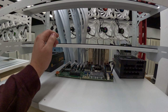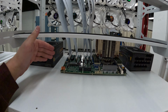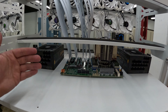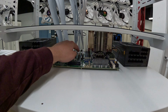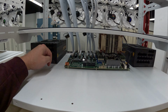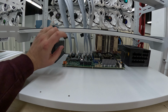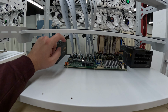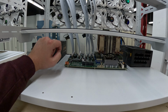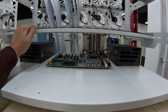But back to what I was saying earlier, and my understanding of it at least, is that it'll be able to load balance and pull from the wires because the GPUs will not be underpowered whatsoever. But these do pull up to 75 watts per PCIe lane, and some people mentioned possible burning or something of that sort. These are very high quality cables. But that said, we have not really seen any builds done like this, so we will keep a watchful eye on these, especially as we get them ramped up.